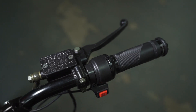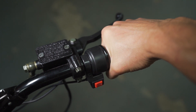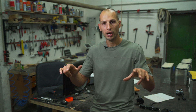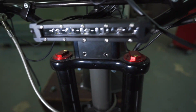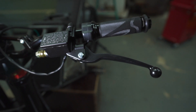We absolutely love having regen on the left thumb when you have the throttle on the right side — you always have brakes. No motorcycle has this third dynamic element: a variable regen on the thumb. When we have sensors that cut off the throttle, that means when you brake with mechanical brakes your throttle is deactivated. On these builds we've also been using brake lights, so when riding in a group aggressively, everybody behind knows when there's emergency braking.